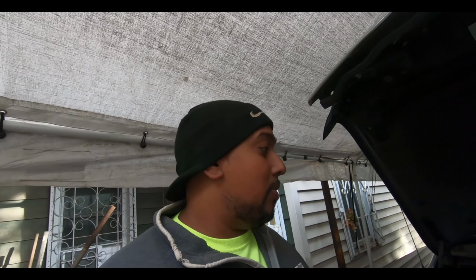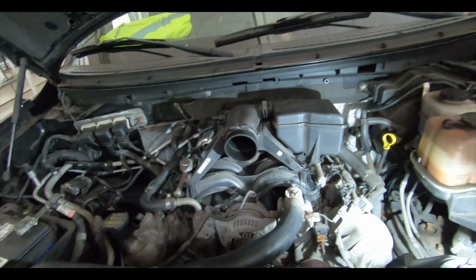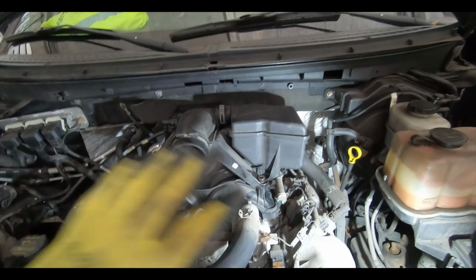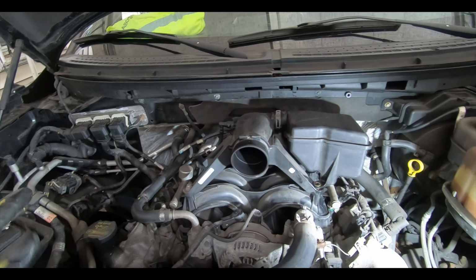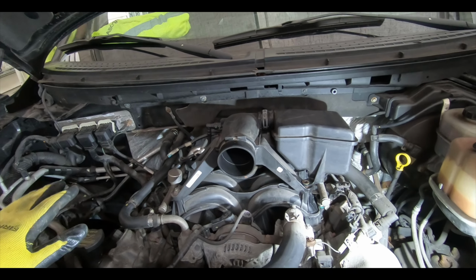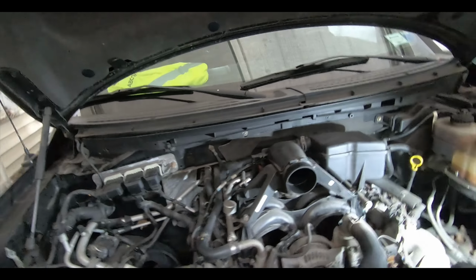If you guys are familiar with these motors, everyone hates them for the way that this oils the motor. It comes from one side, works its way up one side and goes to the other side, and once it gets warm, it seems like the oil pressure on one side doesn't do quite as well of a job lubricating the system on the passenger side, if I'm correct.